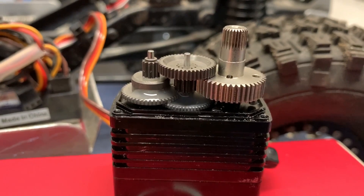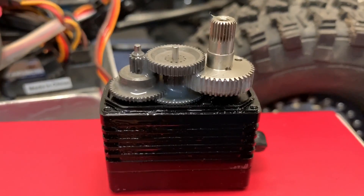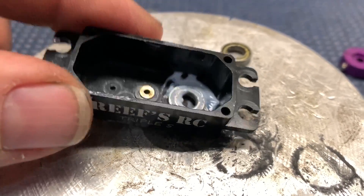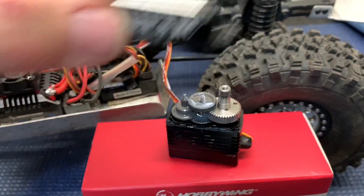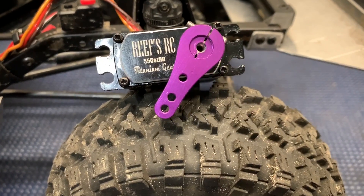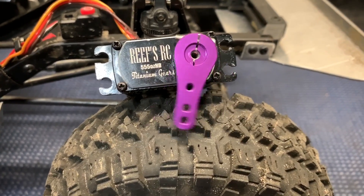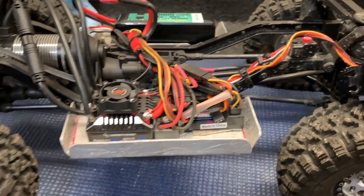I'm just going to add a little more lube and then put the O-ring in place. Just wanted to show you guys it is very well lubed. Got the new bearing in the top piece — that went in pretty well, a little snug but it got into place and it's obviously lubed up. Now it's time to assemble once I put the O-ring on. Servo sounds perfect and it's ready to go right back in so we can take Grimlock out for a drive.